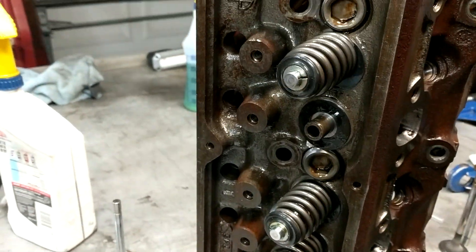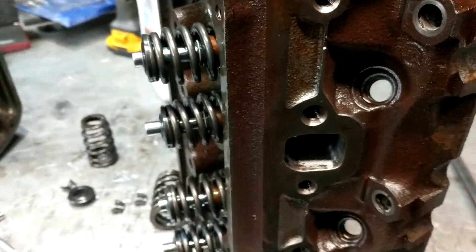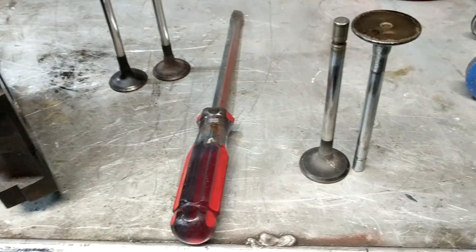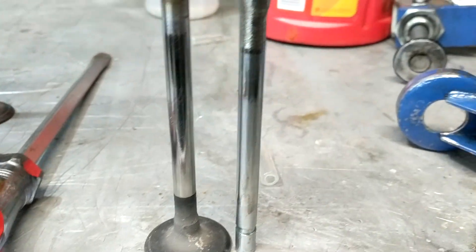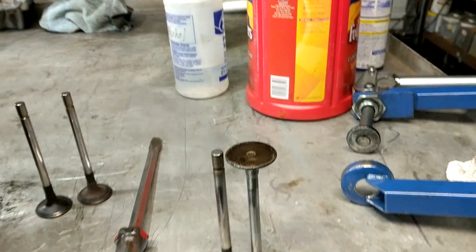I looked on the other head and had two more that were the same way. I've been using kind of a mishmash of parts - I had E7 valves and E6 valves. I noticed the E6 valves had a little divot on the bottom after I got them prepped and I said, well, they ain't gonna matter. But look at that - they do matter. Little stuff like that will bite you in the butt if you don't pay attention.